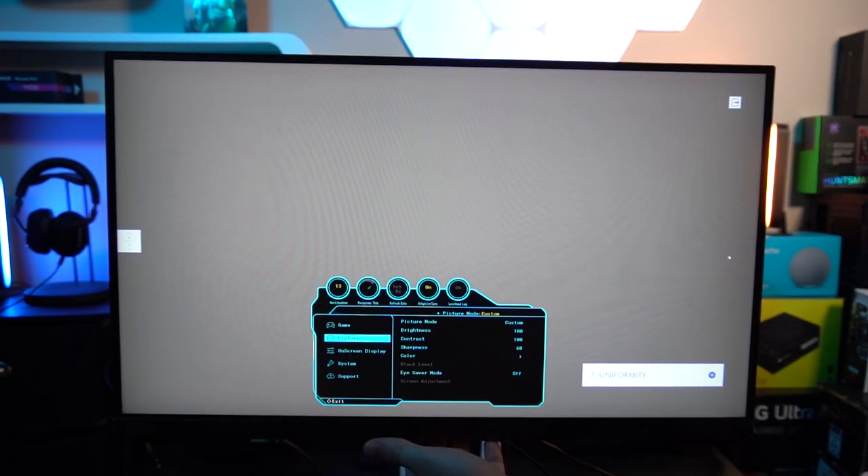Uniformity matters when panels are downgraded. Unlike the G78, this monitor has no full-array dimming. Testing at different brightness levels, there was some non-uniformity around the corners and edges, though the center performed really well. For backlight bleed, I used a black backdrop and a mouse to check the edges and corners — the G50A actually does a very good job, vastly better than many monitors I've tested.